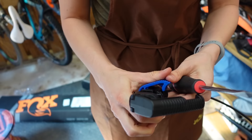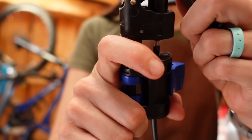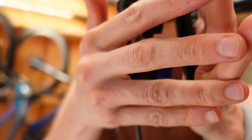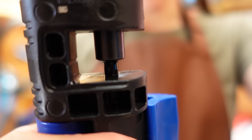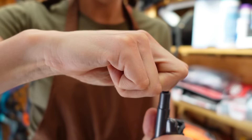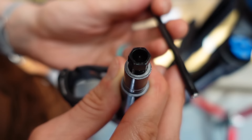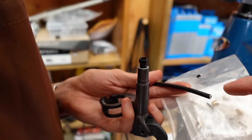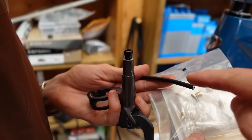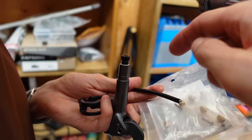That screw on the bottom — if you are pushing your thing through. Show us what it looks like there — you can see it's all the way flush. I'm going to pop this off, but hold it upright — that is crucial. That is the oil plug. When in doubt, hold things so that stuff doesn't fall out of them. Olive is already installed. Basically, the olive is like a gold ring. If this were not a brand new brake, we would have unscrewed this, put that on first, then put the gold thing inside that, and then flipped it in and screwed it down. But because these are brand new brakes, they just have this partially installed for you with an olive in there — you just stick it down.